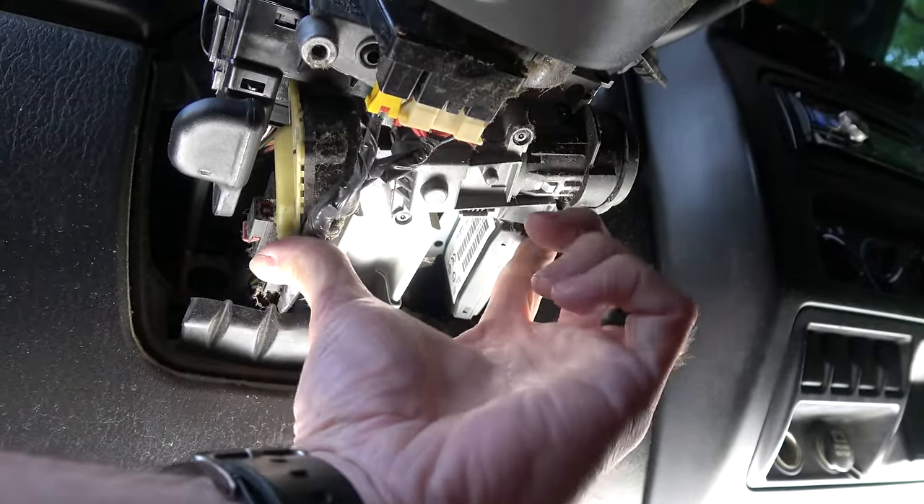Here's the actuator pin and ignition switch assembly. In order to pull this out, it's basically just clipped in. I think the easiest thing to do is just apply a little pressure and work it out — and boom, check it out. So yes, this was definitely my problem because this is broken. Here's the piece that broke off. So this is broken — that's why when you turn the key it's not triggering the ignition, which would then engage that starter control wire that we tested earlier that wasn't getting any power. So yeah, there we go.